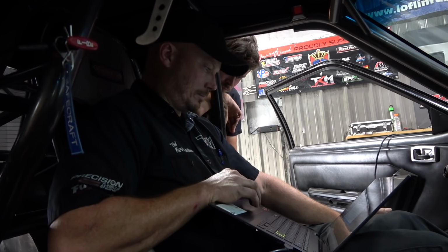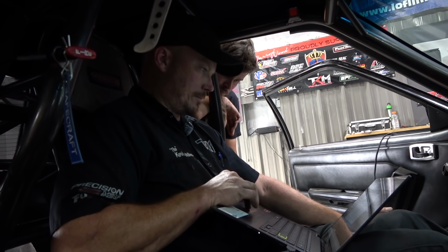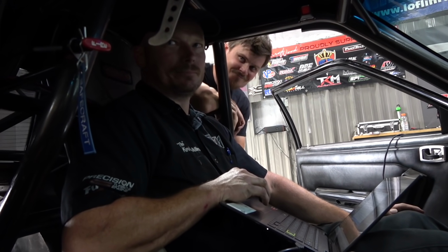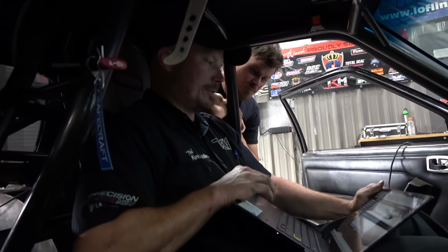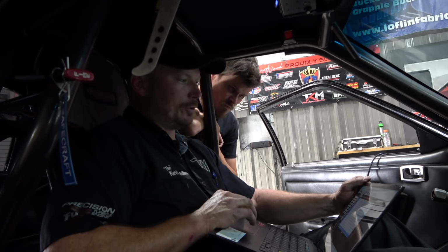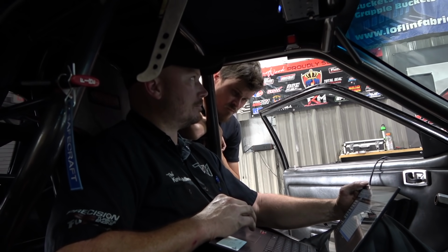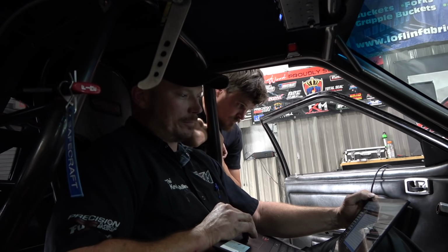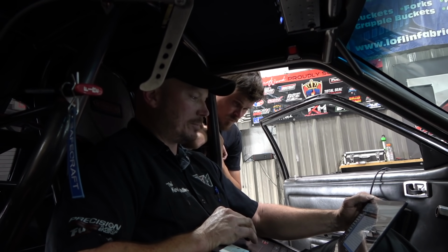We have a good running motor and a tight converter. She's tight. Snug. That's why it's taking so long to get up on the chip, and it's actually pulling the motor down. Yeah. I think if it was a little looser, obviously it'd spool a lot better. It's going to work a lot better when it's really strained on the brake. Okay. Maybe we can work with it a little bit and play with these dumps.